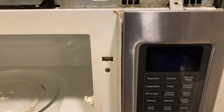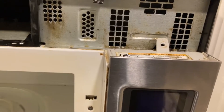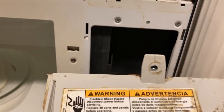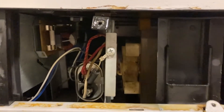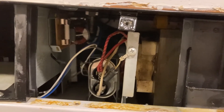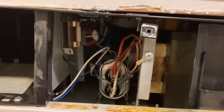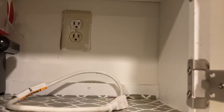The panel of the microwave is going to lift up a little bit and then lean forward. I pushed it up like this and now it leans forward. That's our fuse right here on the back. On the left-hand side, I'm not going to touch anything yet — there's a capacitor right here. I want to make sure that the current is removed from the capacitor, and again I'm confirming that the microwave is not connected to the power supply.